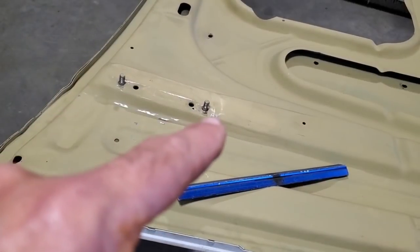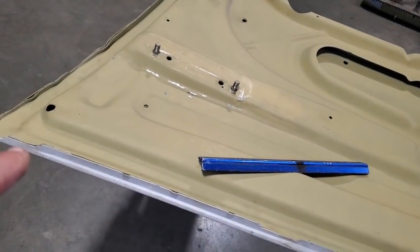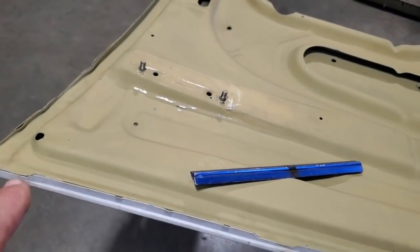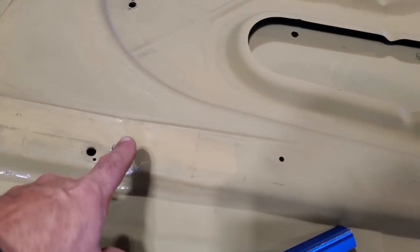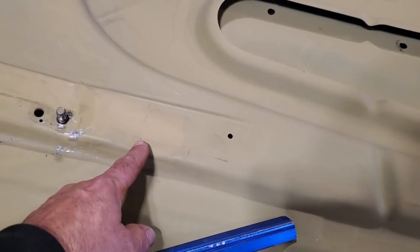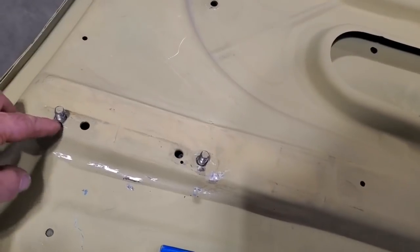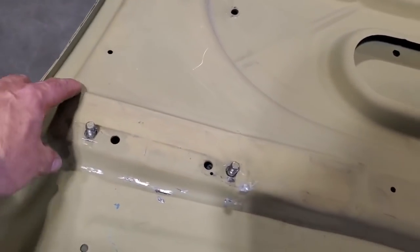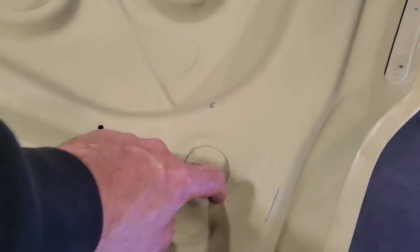When I bolted the hood on and adjusted the rear hinge, I could lower the hood to the point that the back was too low - so I know I could build this up a bit to fix the problem and still have adjustment so the hood won't be high in the back. The plan is to pull this up with a little jig, then make a plating system that'll go over where the hinge went to. I'm going to build a plating system to go up to here, spot welded on, dressed around - I'm not going to weld it on solid or solder it or nothing like that because you don't want to get into filling all this.